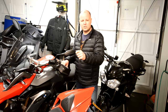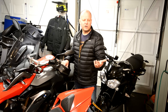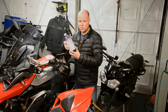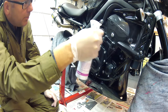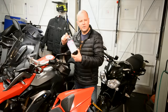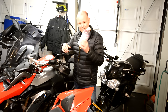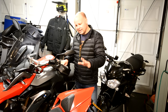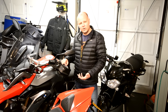One other thing I do, twice a year through the winter per bike, is add a protective coating of ACF 50. It comes in these little bottles — I buy it in bulk because it's quite expensive stuff. Spray it on the bike once it's nice and clean, then bring it indoors. I've got a separate video on how to do that. It makes sure that if you get caught out in heavy rain on greasy, salty roads, the bike is protected from corrosion. On bikes I've had for some years, all the fasteners are still looking nice and shiny, so I think it's worth doing.